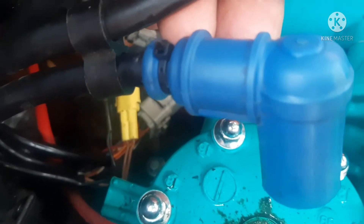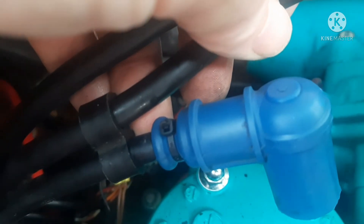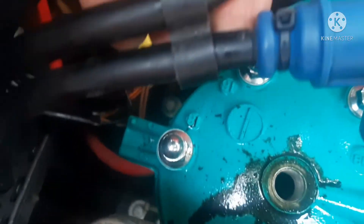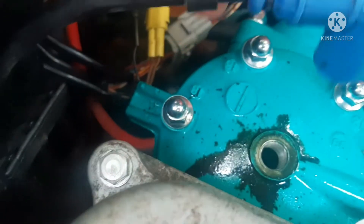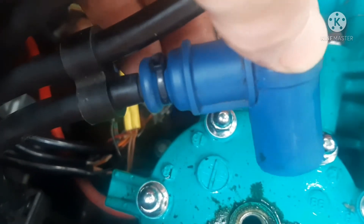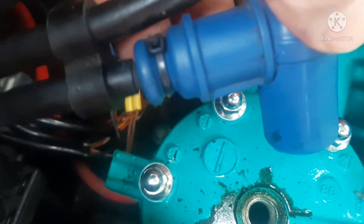This ski wasn't running properly and I could only get it to run about 30-some odd miles an hour on the lake — now I know why. My boot pulled loose out of the cable here, and apparently even when I re-threaded it, it's still not firing on the back cylinder. What I'm going to have to do is cut maybe a half inch of the cable. By the way, these boots unscrew from the cable just like a motorcycle — it's got a post in there. The boot itself can actually be bad; you can check that with a voltmeter. I'm going to have to clip this cable and re-thread that boot onto it because I'm not getting spark to my back cylinder.